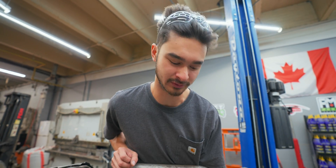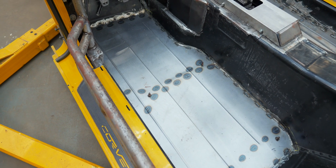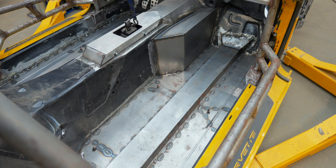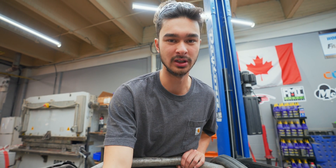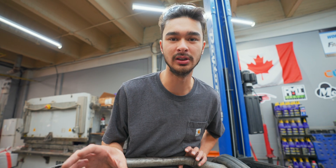Finished the steel floors in the Corvette. Driver's side is fairly simple - we replaced the fiberglass and wood floor with a sheet of sheet metal that's been bead rolled. What that does is it lets you sit the seat a lot lower. On the driver's side I did a little notch for the transmission for more room. But other than that, driver's side is fairly stock. Passenger side has a bunch of tunnels and stuff for lines. Now that all this is done we can continue building more drivetrain-related components and run water lines through this little tunnel.